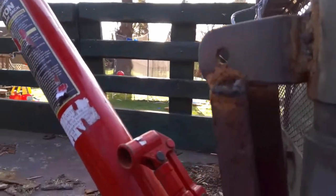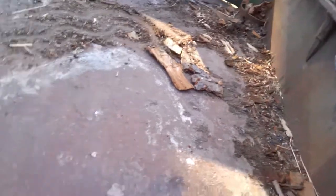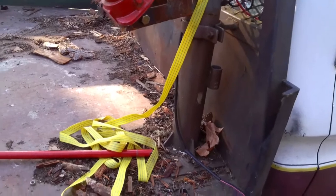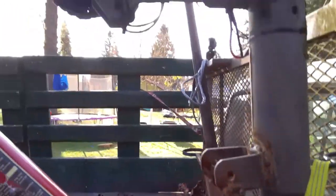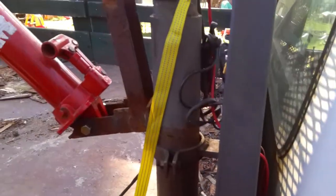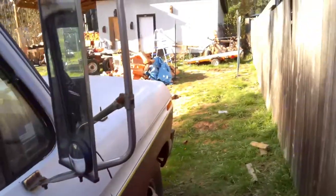You can actually lift up on this and then pump this way faster. I have an upgrade in mind - I actually got a 12-volt hydraulic pump, like the ones people use to make a dump bed. I got one from my cousin and I'm thinking about putting a short hydraulic cylinder right in there so it's much quicker - either wireless or plug a remote in, or maybe put a little control box there. I've already routed the power lines down through a fuse into the battery.